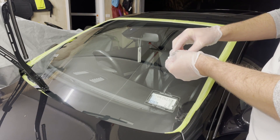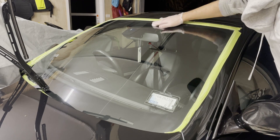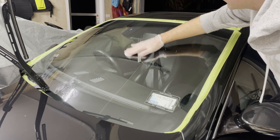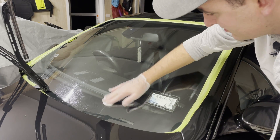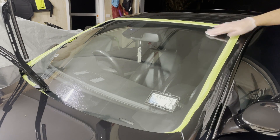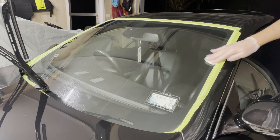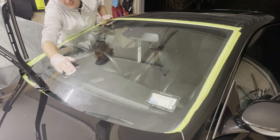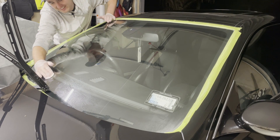Now we're ready to apply the coating. In the packet it comes with about three or four small applicator pads. We're going to want to prime the applicator pad first — put a generous couple of drops onto the pad to begin with. Make sure to wear gloves for this — you don't want to get this coating on your hands, it's not very nice on bare skin. Once the pad is primed with a good couple of drops, work the first coat into the glass in circular motions. When the applicator pad begins to feel dry, simply top it up with a couple more drops and continue in circular motions across the entire panel. Once you've finished the entire panel, leave it for five minutes to let it cure before applying the second coat straight over the residue.